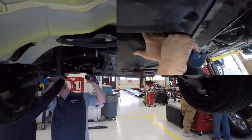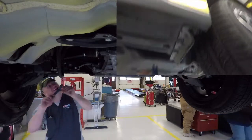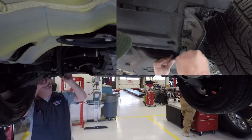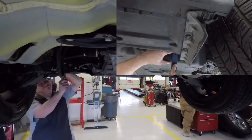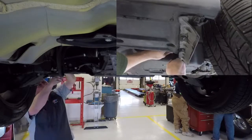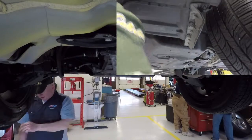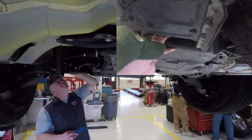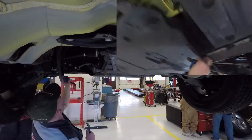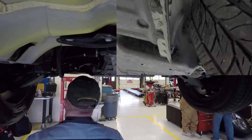But there's two extended bolts, studs actually, that screw into the front radiator support and extend down, and that's what the body armor will mount to on the very front. That goes into where there's two white clips that are exposed when this underskirting is removed. Just pop those out of the way, and then the studs get screwed in there. The instructions kind of lay all that out.